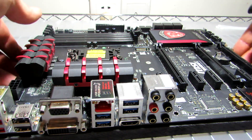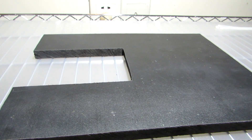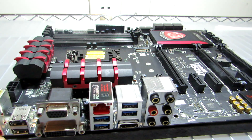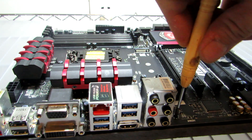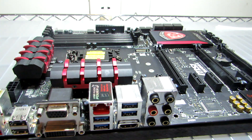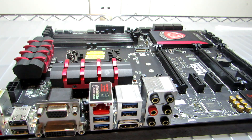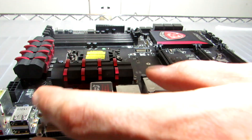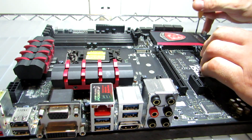Somebody had asked me what I use to mount my motherboards. I simply use a piece of PVC plastic that I've cut down, cut a hole out for the CPU, and it's the shape of the board. What I do is carefully center the board, then take a small screwdriver and put that into the center of the hole, and push down on the board to leave a mark. After I've left my mark, I push the screwdriver into the hole even further so that I can fit some motherboard mounting screws in there and mount my board directly onto it. I push the screwdriver into all of the motherboard holes to mark my PVC board so that I can put the motherboard mounting screws into the board.